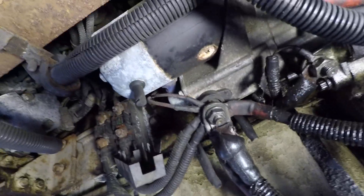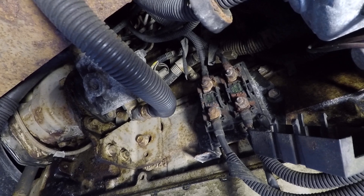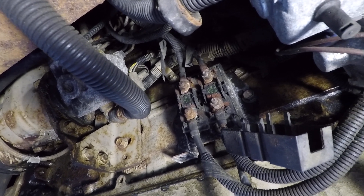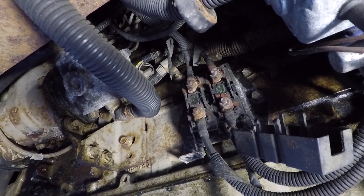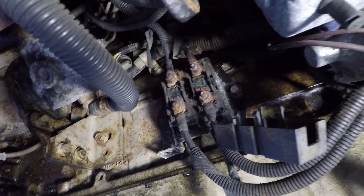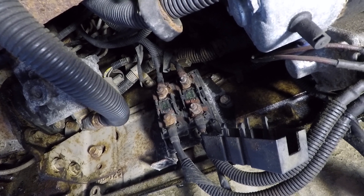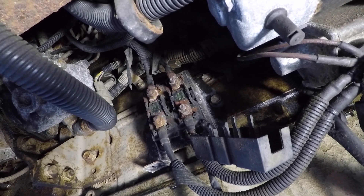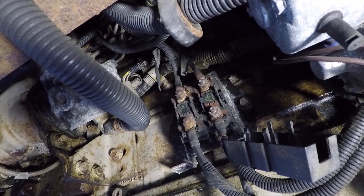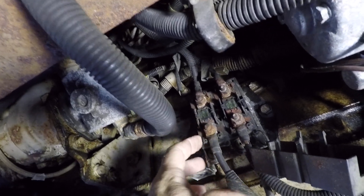There's the big negative wire going to the negative, which is good because this must draw a huge amount of current. With electrical stuff, you can put a meter on it and it says 12 volts, but when you pull a lot of current — like a starter motor drawing maybe a thousand amps cranking — if it doesn't have good continuity it will actually heat up. I do electrical work in residential and commercial buildings with AC power, so I know that any corrosion creates enough resistance that it can heat up and start a fire.